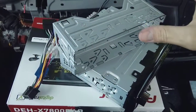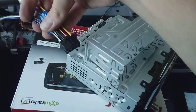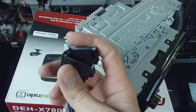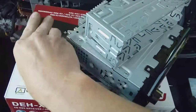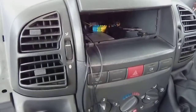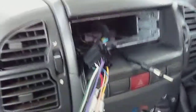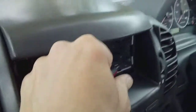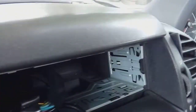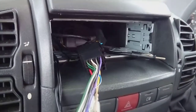The new radio will come with pretty much the same as what you took the other one out with — a metal securing cage that we need to slide into the radio aperture, and an adapter cable that plugs into the back of the radio with square plugs that will plug straight into the wiring harness of the vehicle. Pop your cage in, feed your wires through, pop it in, and then twist some of the tabs up so that it's locked into place. With the cage in place and wiring connectors clicked in, the third connector on this particular vehicle — just tuck it down, not going to need that at all. Don't forget to do your little locking tabs — pop a screwdriver in and just twist, do a couple each side, and that's the security side of it to stop it from pulling out.